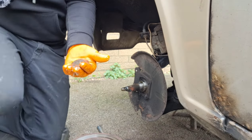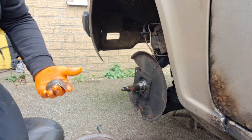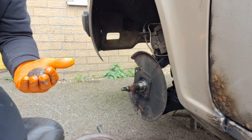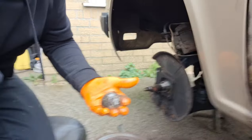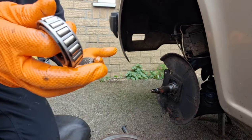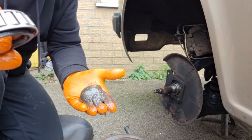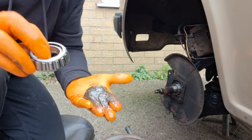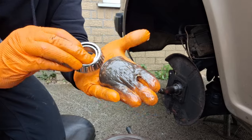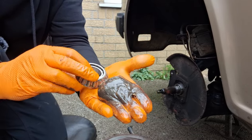Now, there's two or three ways of doing these. But what you need to do is force grease in between the two halves of the bearing. If you just wrap it around in grease, it'll run in it, but it won't be there. So what you do is that edge, turn it, that edge here, force it down into the edge of the grease and just keep doing that all the way around,